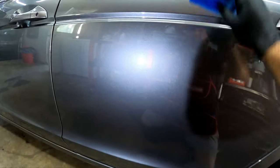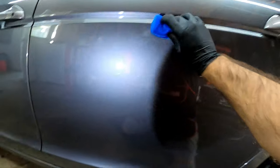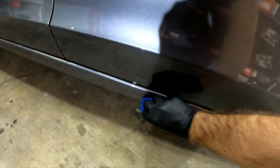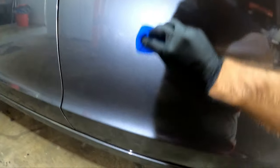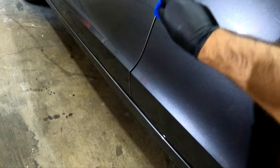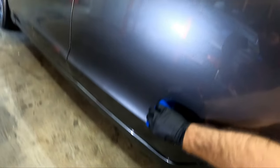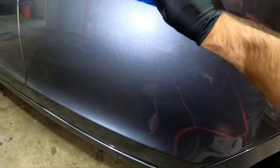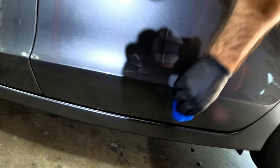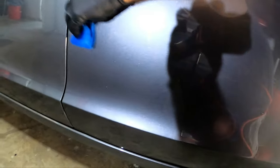I've got my paint light here. I'm going to go right through the center of the door, straight down, straight back up. Sorry, I'm trying to videotape through the camera and not look at what I'm doing — really hard to see on this paint. If you look in the light you can see it. Right through the center, now we're going to go this way. Cross-hatch pattern.